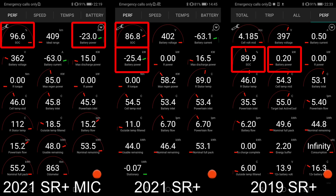You can see a nice flat charging curve for the LFP battery versus the others. The standard range plus classic one also reached 90%, and the middle one will take a while. But again, the middle and right should be similar — Tesla just needs to unlock the power. The LFP battery is no joke: even at 97% it's taking 20 kilowatts. It's almost like a German electric auto — very impressive. Really impressive performance of the LFP battery based on this test.